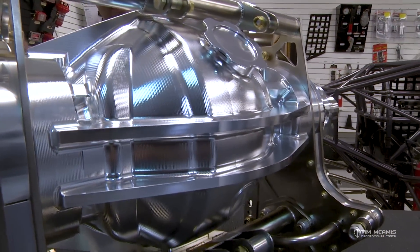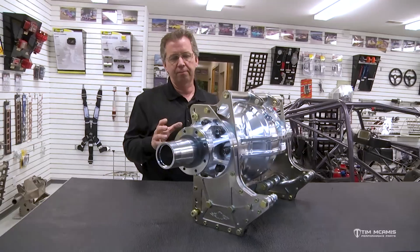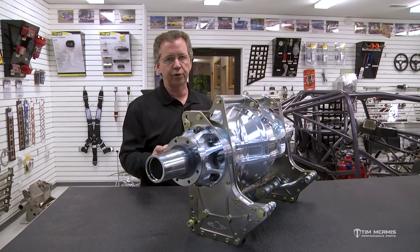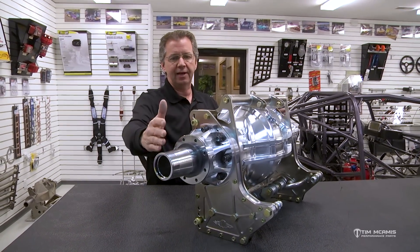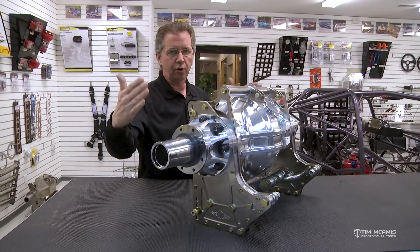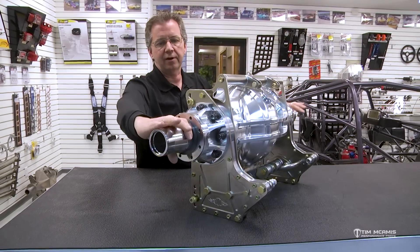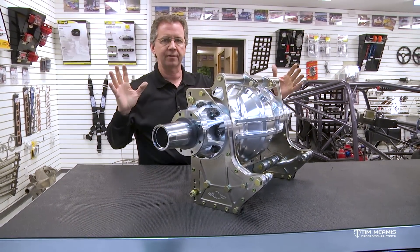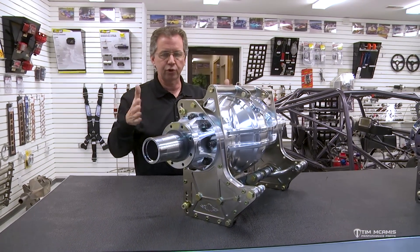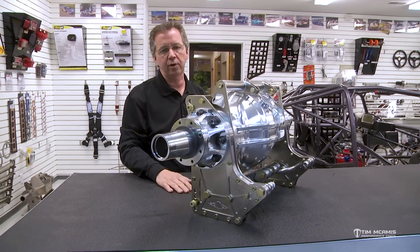Another built-in feature is that, regardless of what anyone says about a welded housing, it is nearly impossible to do a welded floater housing that has zero toe at 36 inches on the tire. If you measure the toe of the rear wheels at the diameter of the tire and try to get two rear tires that are parallel, the slightest variance in the spindle will cause that tire and wheel combination at 36 inches in diameter to have some toe — toe in, toe out, one side could be toed in, the other side could be straight — all changes you can't control when welding those spindles in.